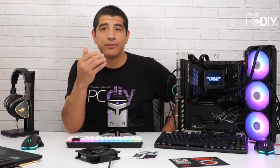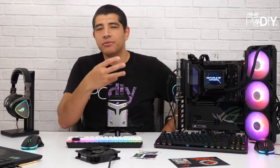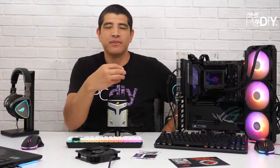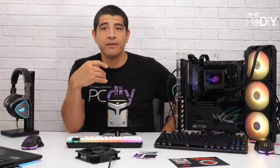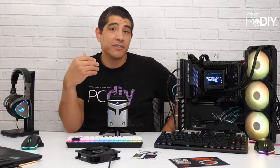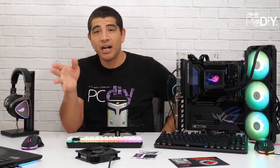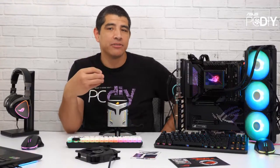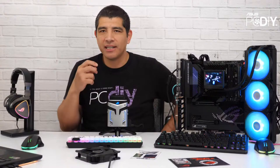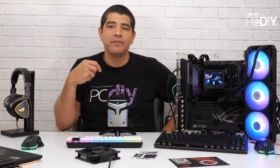There are different types of panels. You have things like a VA panel, an IPS panel, and TN-based panels. Different panels are sometimes suited towards different types of experiences. IPS panels have come to be known for being very good in terms of direct viewing and off-axis viewing, as well as offering very good color gamut and color reproduction. With the latest generation of IPS panels, they can also offer very comparable response speed, so essentially how fast that response time is. Historically, TN panels have usually been the fastest. So for people who always wanted the fastest display for the best motion clarity, response and input lag, they would usually go with TN.